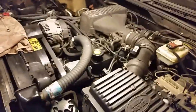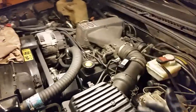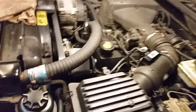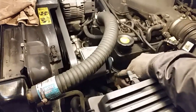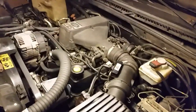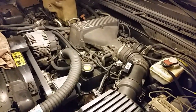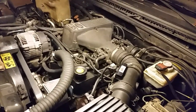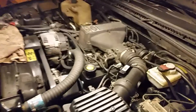I know where mine is. My condition here is blown head gaskets, because when I was running it, I could see the water squirting out on the bottom of the head on both sides. This is kind of worrisome — I hope I don't have a couple of cracked heads on the block of this engine.